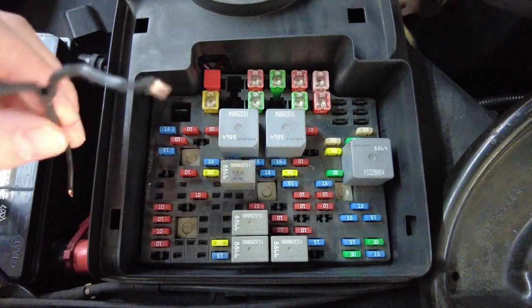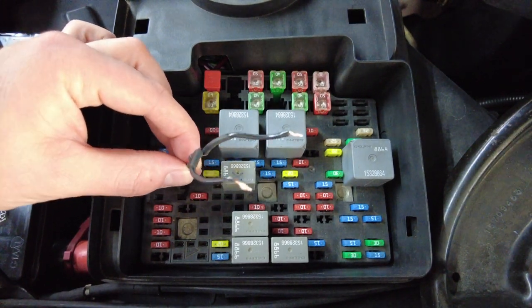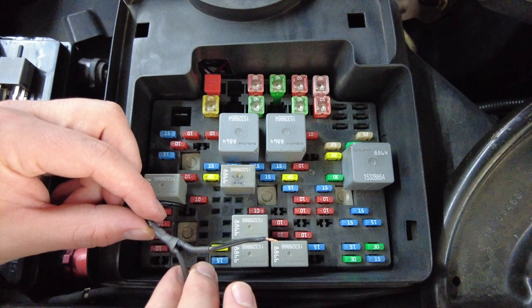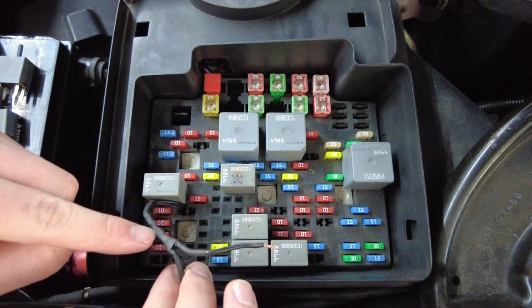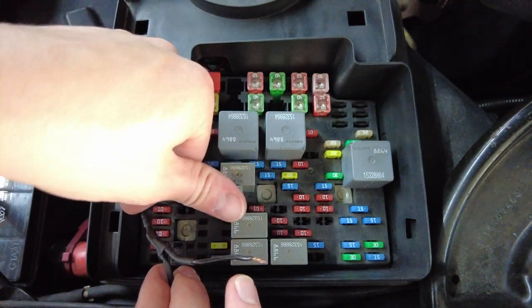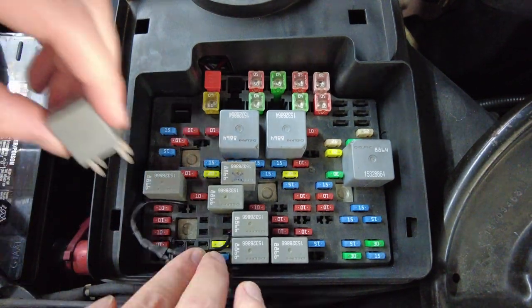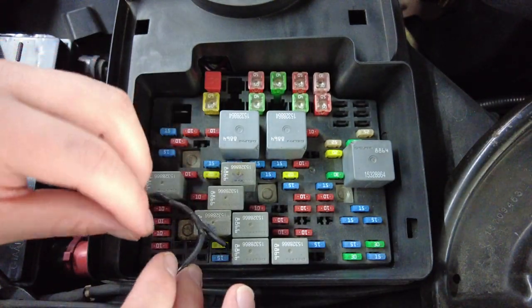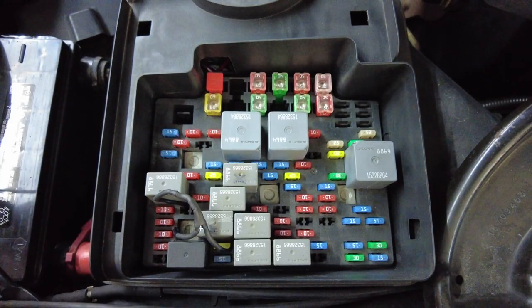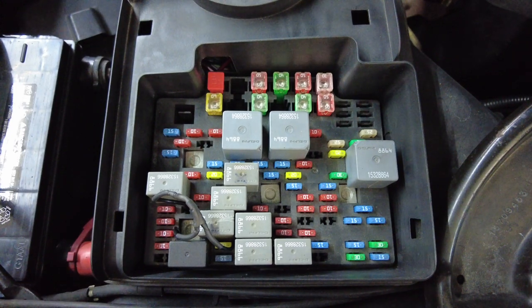For the diode 6-high mod, we have our harness here with all of our relays pulled off to the side. We're going to stick the negative end of our diodes into pin 85 of the high beam relay. If you were doing the 8-high mod with the daytime running lights, you would have soldered one extra diode and run that wire to pin 85 of the daytime running light relay. Next will be our low beam — we are going to run that to pin 85. And last but not least, we are going to run the last wire to pin 86 on the fog light relay. We have this little spider here — we probably could have routed it a bit cleaner, but it is a cheaper option to the $25 Fleece motherboard.